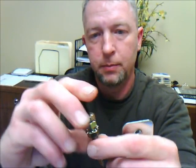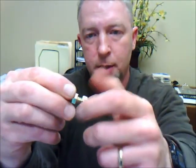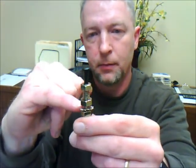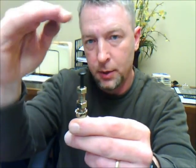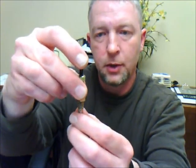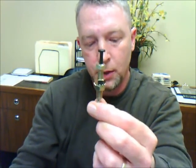I'm sure most of you are familiar with these. This here is just a plastic inside, metal outside case pin switch — non-adjustable except for these nuts right here. So if you had a hood and you wanted to raise it to match the hood, you want it to come down about a half an inch, you could adjust it here, put it inside, lock the lock nut underneath, connect it to your alarm's ground input, and there you go. That's a wrap. This would be the regular everyday kind of pin switch.